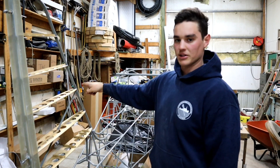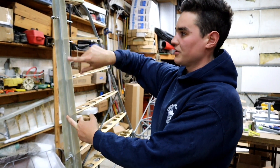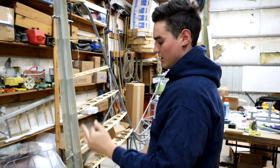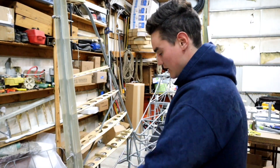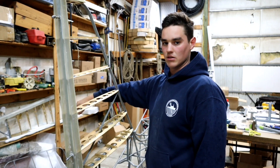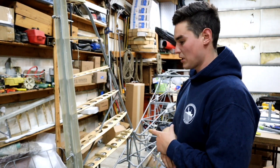This was done — same process in the rudder. Right now we're making this airfoiled section, which basically streamlines the whole tail section. This is a fiberglass part that pops right on there; you see it's being held in place by the rudder eyelets. I've got to trim all these ribs down so that this fits and is perfectly streamlined. Same thing with the rudder — you can see it over there. That has an airfoil section, like a leading-edge cuff, that has to be trimmed down and properly fit.